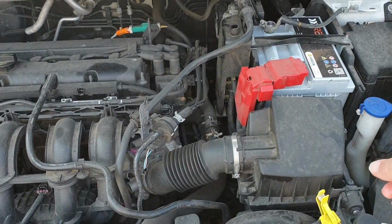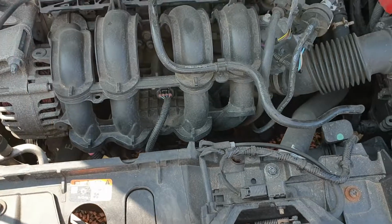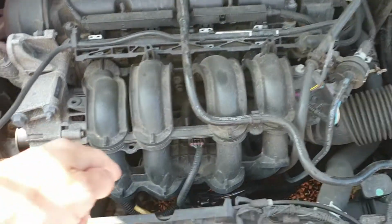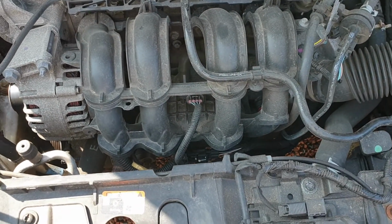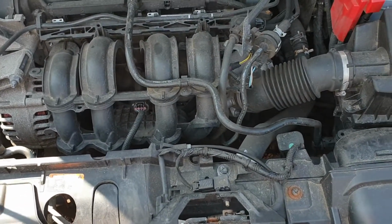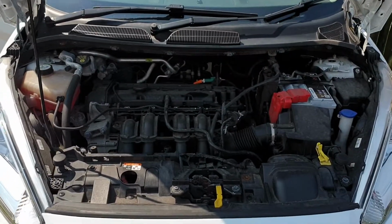You just keep your water reservoir topped up. Your dipstick's a wee bit different. You take that out, you clean it, put it all the way back in, make sure it's fully inserted, bring it back out again and check the level of it. And you also need to check all these levels when the car's on level ground. That's really important. Okay, hopefully that will help.